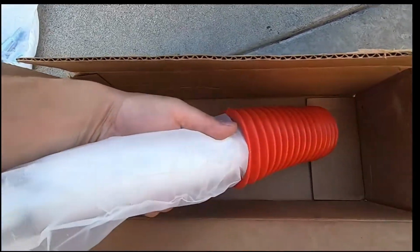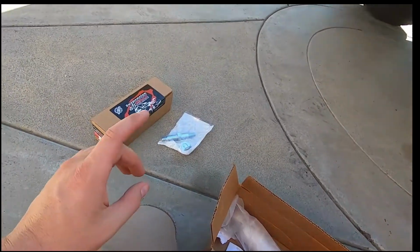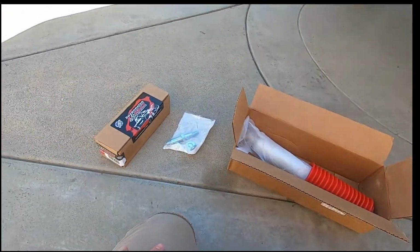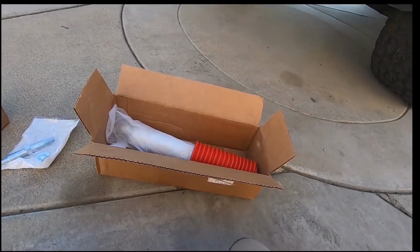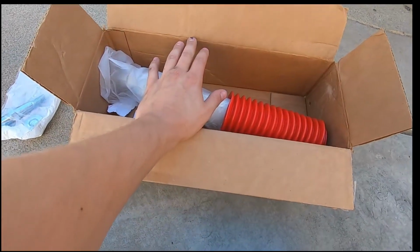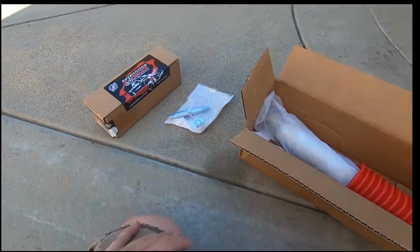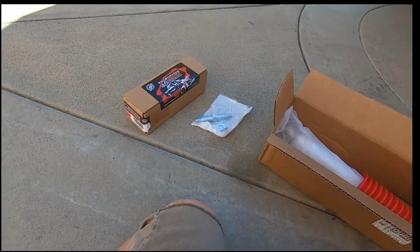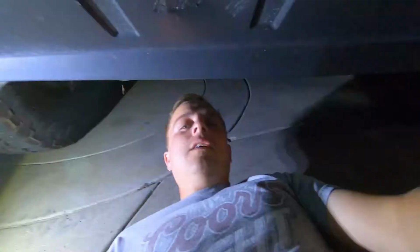these. And the reason I say that is that it's very important which one you put underneath the truck, because some of you guys think that Fox makes a steering stabilizer. They don't make one for this truck. And Bilstein does make one, but the design of the Bilstein, at least for most of the ones I've seen, is going to cause a steering pull if you put it on there, because it just wants to expand and keep pushing away. So anyways, right now it seems like this is going to be the only option, at least from Suspension Maxx.